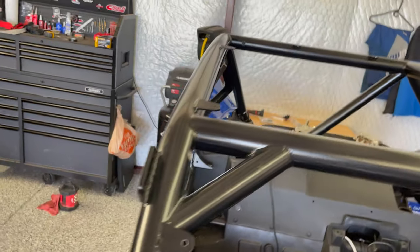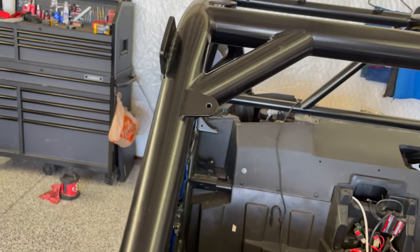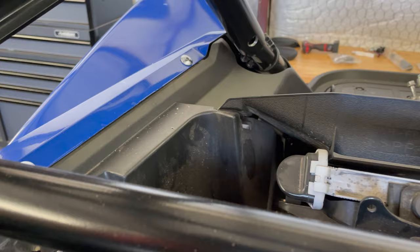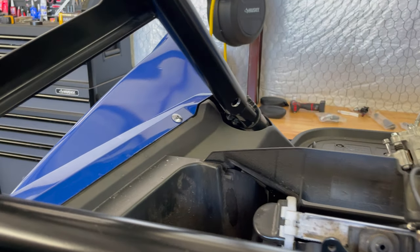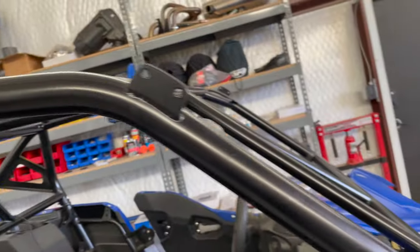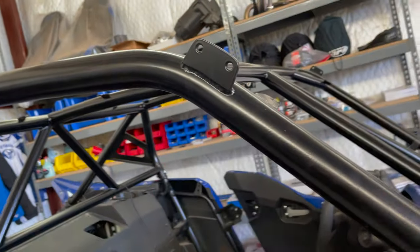I'm starting at the light bar, and I'm fishing my wire from the light end back down to the other end, because that's at the bottom of the cage. So in other words, as I'm pushing the wire, it'll automatically stop at that spot, instead of if I was fishing from there all the way to here, I wouldn't really know where to stop. You know what I mean? The wire might just pass right by my hole.